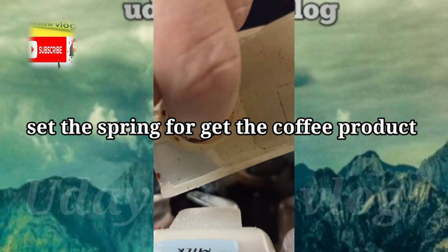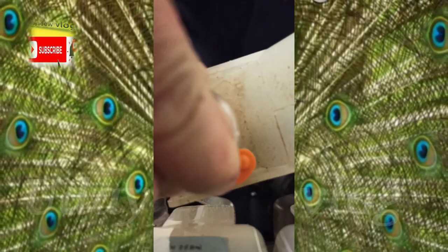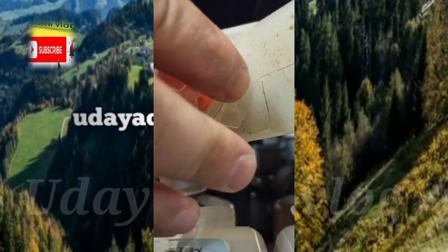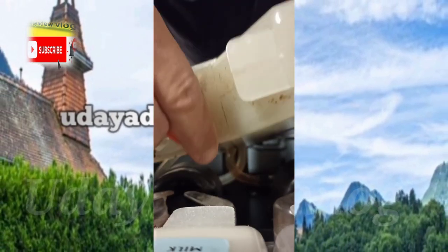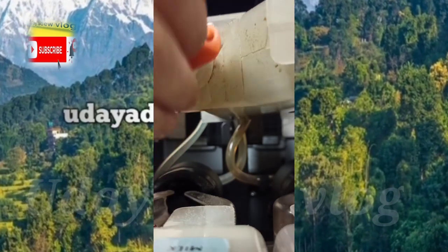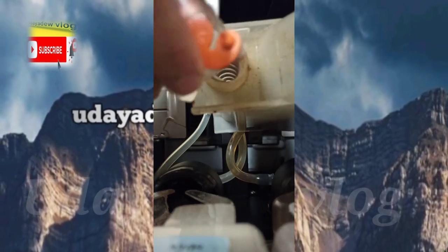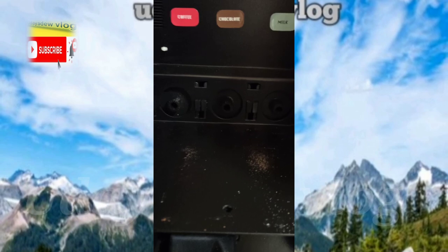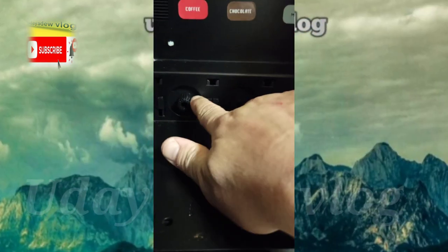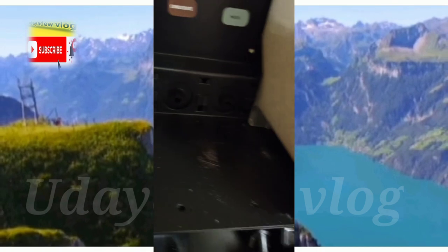This spring will not come to the front side, so the powder is not coming into the coffee. In this case you can get only water. Because it is closed, the water is not mixing with coffee. If the spring is stuck, just take a small screwdriver, pull from the front side, and fix the spring again. When you remove this, check this pointer — this is the motor pointer. Put it back nicely to contact the motor terminal.